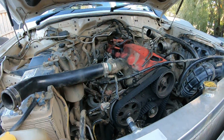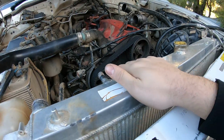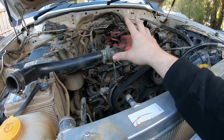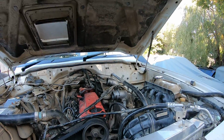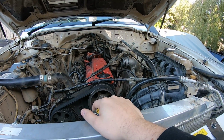Now, as you can tell, I am bloody excited to get rid of this motor. First of all, we're going to start pulling it apart bit by bit. You probably saw in the last episode when we did the cylinder head, we started on the intake side and worked our way to the exhaust side. So first, I'm going to take the radiator out to make everything a bit easier, take all the turbo piping off, and then start on the injector side of things, all the wiring loom stuff. The injectors are going to stay in, obviously. Then all the vacuum lines up the back, the exhaust, engine mounts, and fingers crossed, that's it. I've taken this engine out before when we did the initial rebuild about 8 months ago, so I sort of know what I'm doing.